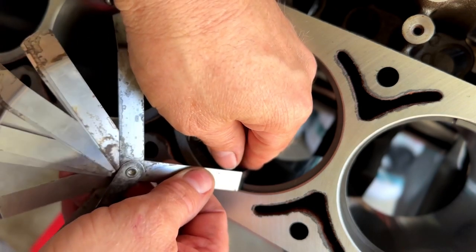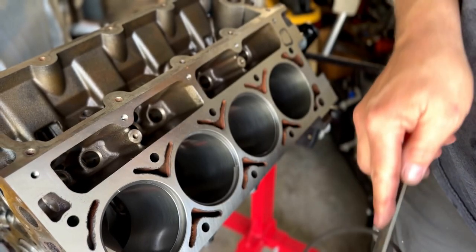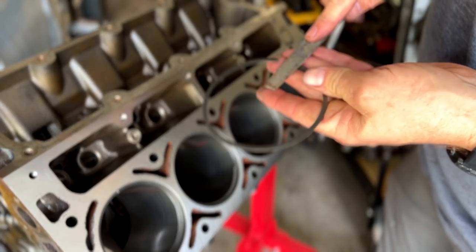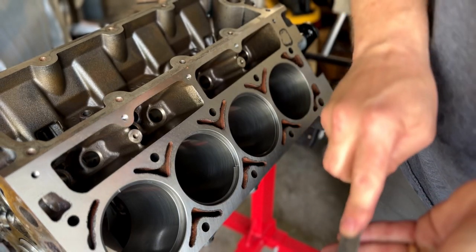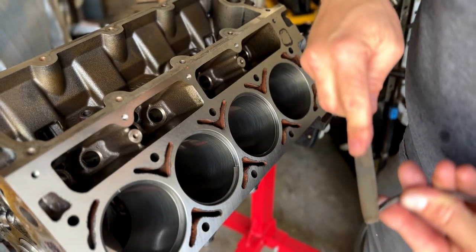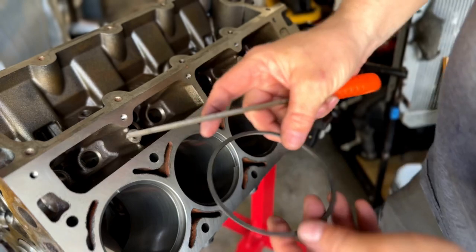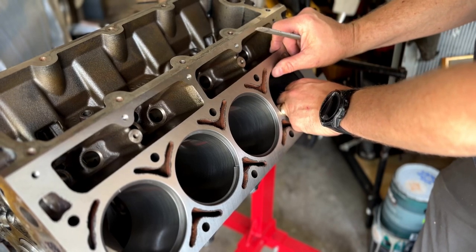On the first day we had music playing so I had to do voiceovers, since YouTube doesn't allow that. I thought it'd be cool to hear the ring file-fitting process. The ring gap on this kit is 0.024 — that's for supercharged or turbocharged applications — and for a race build they recommend 0.028. This assembly is rated to about 1200 horsepower, so I could run 0.028 and push to 1200 hp, or stay at 0.024 for around 750 hp.